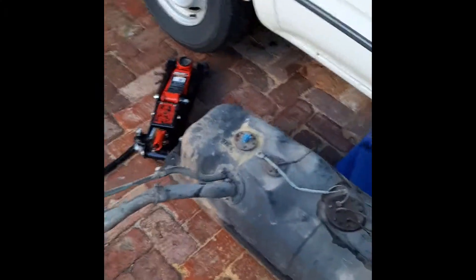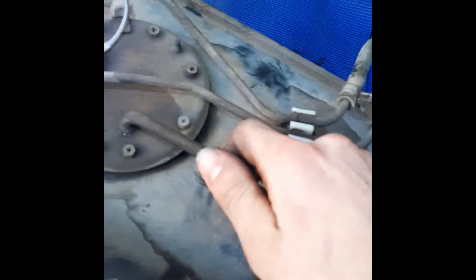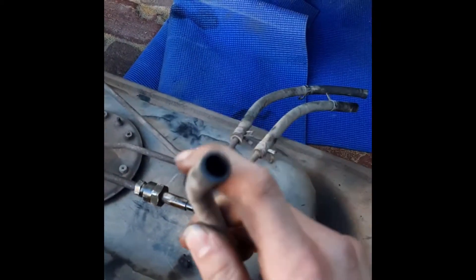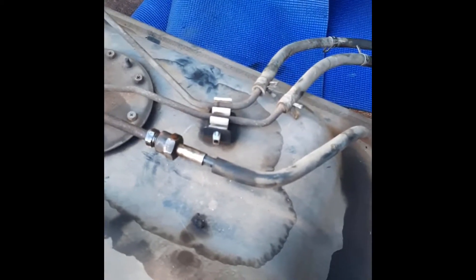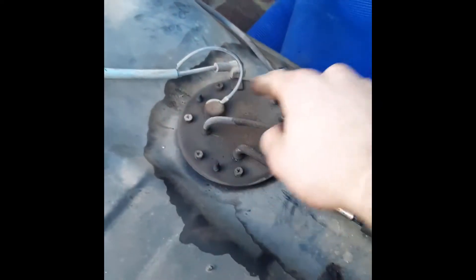I just managed to drop the fuel tank from the Hilux - it's a bitch of a job. This flare fitting here was completely stuck; I tried absolutely everything and almost rounded the sides of it. It's a nylon line, so I just snipped it and I'm going to put in some rubber hose line, or I might even run AN lines all the way to the fuel rail, we'll see.